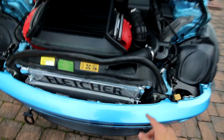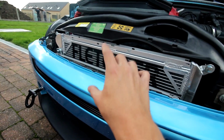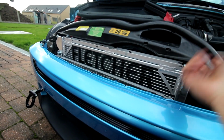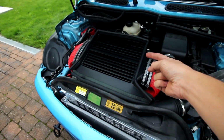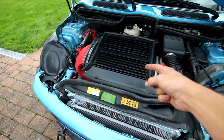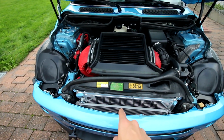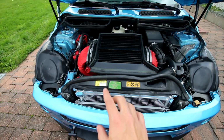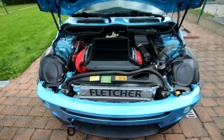Now this radiator actually is a bit thicker. It also has two cores, so the coolant will pass twice through this one before it goes back to the engine, so that means we have better cooling already. So we have an upgraded radiator there and an upgraded intercooler for the compressor. Now, full disclosure, this is an eBay radiator, guys, not sponsored. Really like the quality, and hopefully she keeps together on the track day.